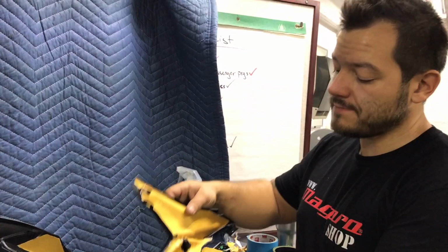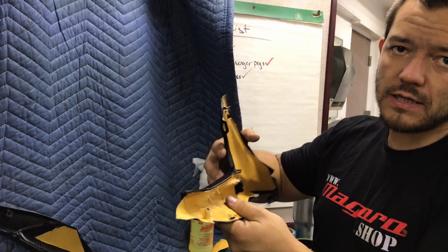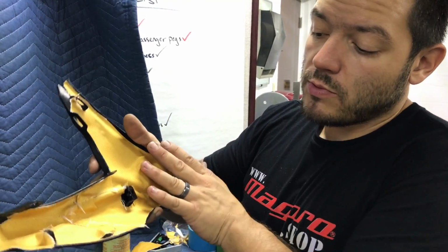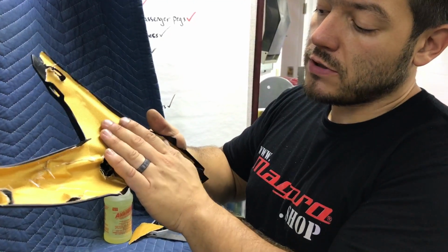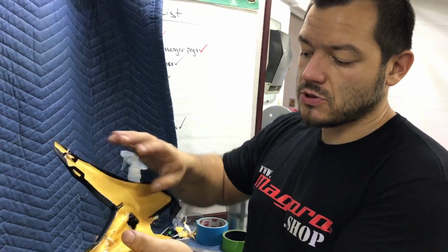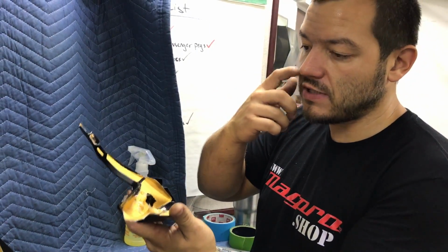And I wanted to mention something else. Somebody had said this bike was designed to have certain areas with the heat, like this is why some of the heat shields were put on and other ones weren't. No. So what happens here is this plastic will soak up a lot of the heat, and with it being on the side of the motor and side of the frame, when air is moving this way, we want the air to be contained here and then moved out. We don't want it to soak into the plastic or just come straight up, or radiate straight out, right? So we want this plastic piece to be protected by it. Could they have done it? They did it on some pieces, not the whole bike.